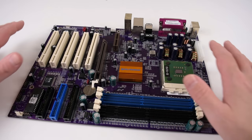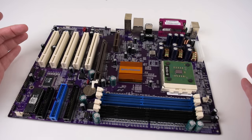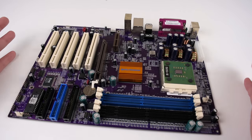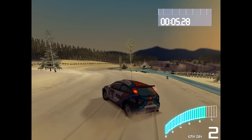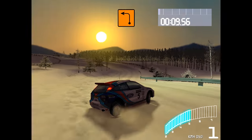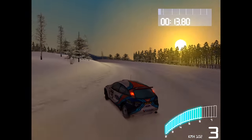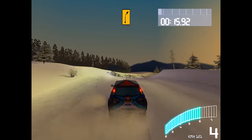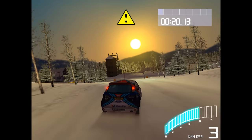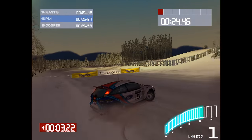The motherboard has a very clean layout. There's only just a few jumpers, one for the CMOS clear and one for the audio, but otherwise it's jumper free. That's lovely. All the resources are on the website, but you do have to use the driver disk to get some files. Not all of them are on the website. With the latest BIOS, I had absolutely no issues. SDR and DDR support, that's really a nifty feature, good for memory testing. Are you going to use SDR these days? Very unlikely. DDR memory is dirt cheap.